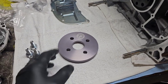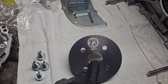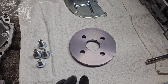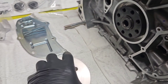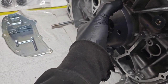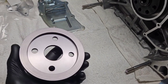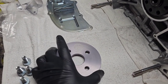I'm going to start with the rear main seal. This is my first time using this, but we just got this really fancy Company 23 rear main seal installer tool. This thing is pretty cool — it should install the rear main seal perfectly every time because you just bolt this thing on and pull it in completely even with these four bolts it comes with.